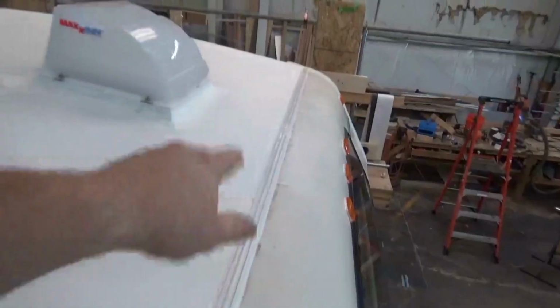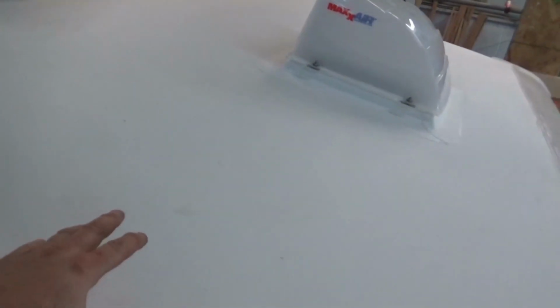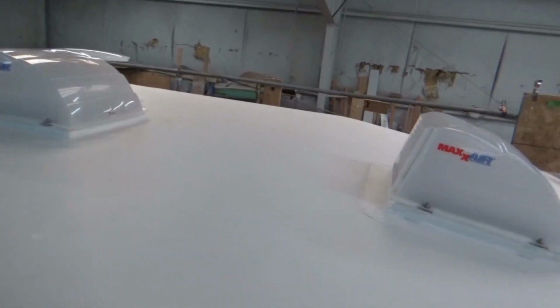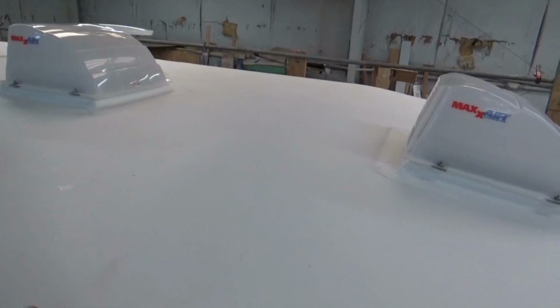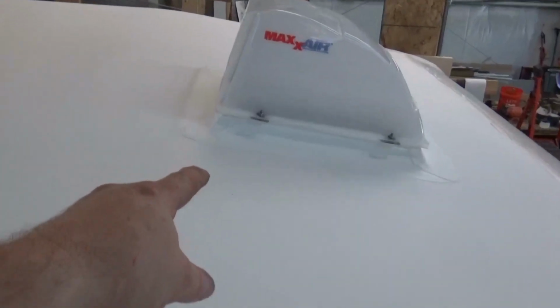Got 2 layers of caulking running down here. Got all our curbs on. Now this roofing material, this is a 60 mil commercial grade roofing material. Same product you're gonna find on a hotel, you'll find on an office building, a restaurant, that type of thing. Structured means it has a weave in it. That is good for impacts like hail or even tree limbs for that matter. And if you did get a tree limb hit the roof, we can do a heat weld patch just much like we did the curb.